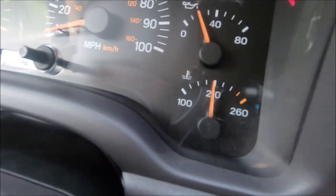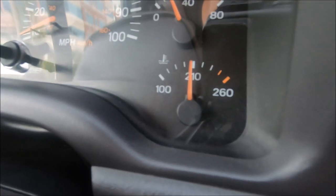If it goes above 210 and hits 218, the electric fan will kick on and cool it back below 210. Or if you just start driving and give the Jeep more airflow, it'll also drop below 210 — exactly what I experienced on that 100-degree day when I picked it up. We've been sitting here for about a minute and the temperature rose just a little bit, but it's just barely below 210. Today it's 86 degrees and it's running just fine — the electric fan still hasn't kicked on.